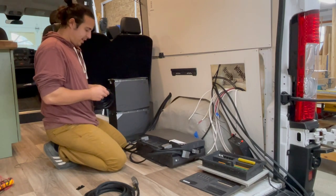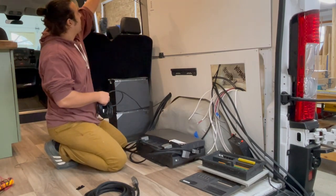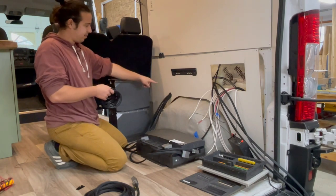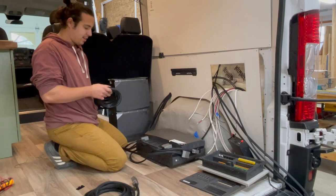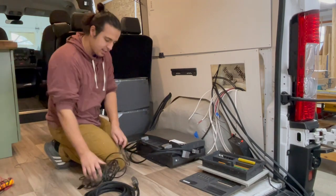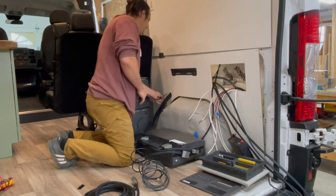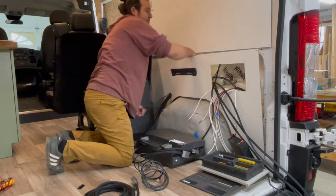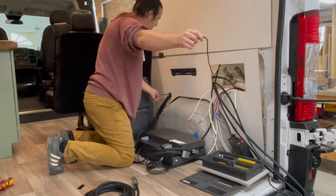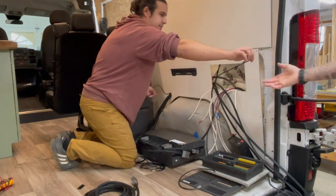The only wire left is our communication cable. One ethernet cable is already run through the wall and goes up to the top of the van where our screen will be. The other cable will go through the hole and come out into the distribution panel to control those six on/off switches. If you don't have either the screen or the AC/DC box, EcoFlow sends a little plug that goes in the port — the system apparently doesn't work correctly if you don't have one of those plugged in.